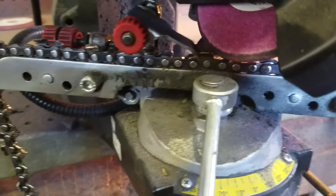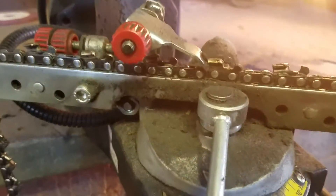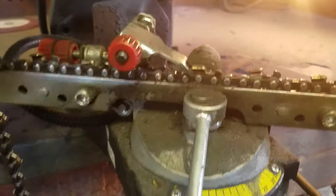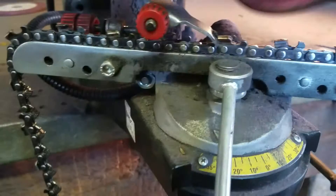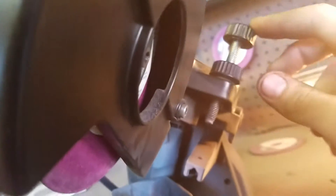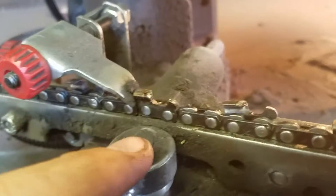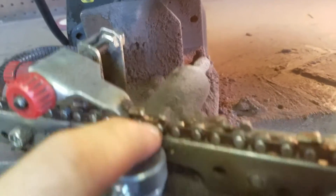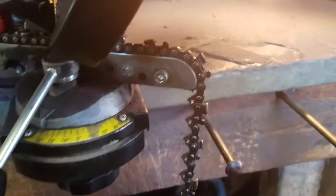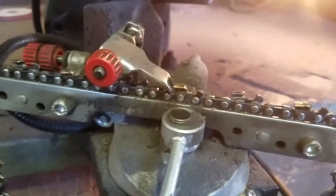You go down — it's still not touching. A little more forward. I like to start out where it's just barely touching. There we go, so it's just barely touching there. On this tooth you don't want to get into here. You go down and adjust until it lifts up off the bottom of that chain. I might have to tighten it just a little more.